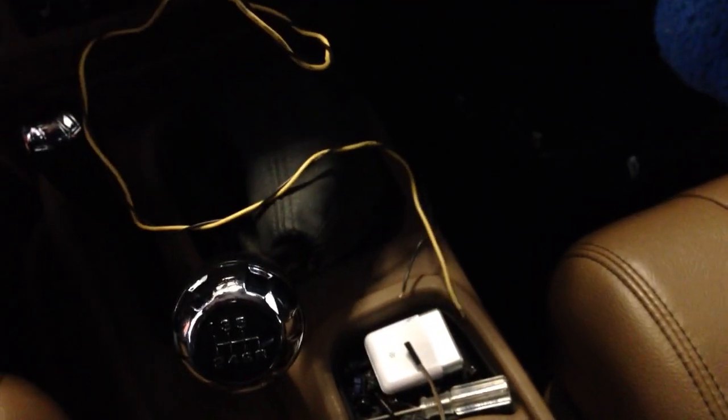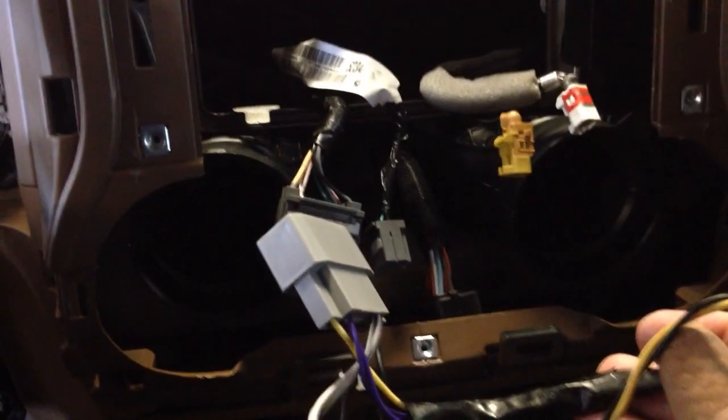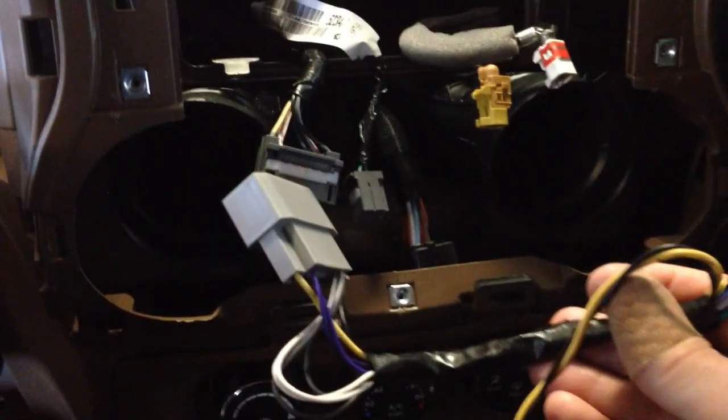You do have to be a little careful you don't short out the CAN bus when it's not connected to anything. So before I plug the car back together, I'm going to wire that up to the new computer, and we'll be back in a moment with that.